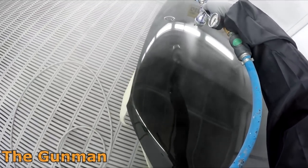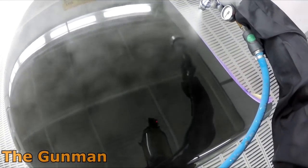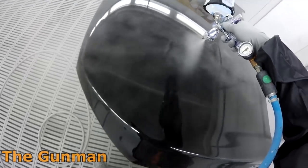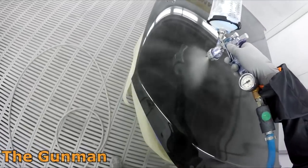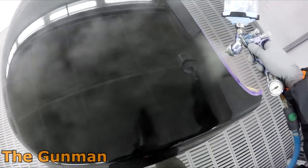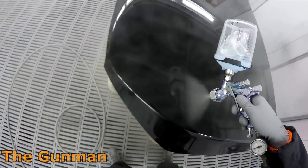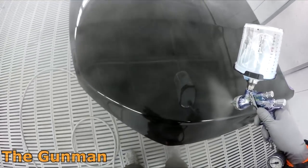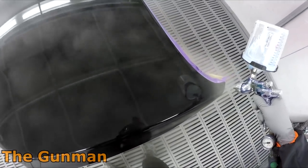So what I really should have done was actually get the water-based degreaser, the orange stuff. There's loads of different brands, I'm sure there's different colors too, but we've got this orange stuff, and you can just spray that over inside and outside of a panel that you're painting, and it would just cut all that silicone off. However, this job here, I just decided to double prep sol it. It didn't feel really silicone-y, that's probably why I didn't give it that extra degreaser.